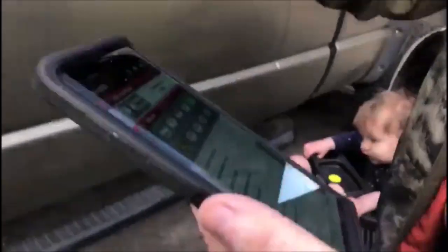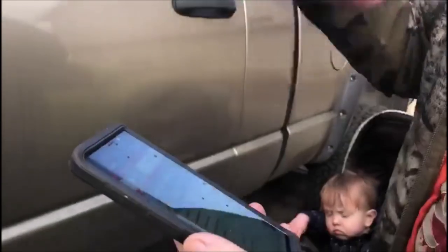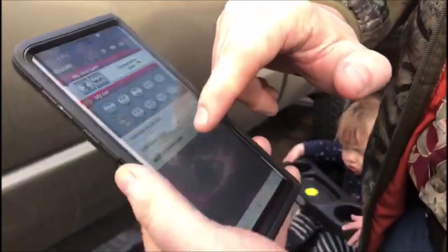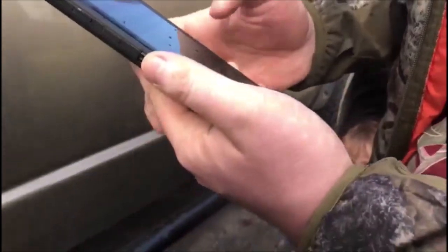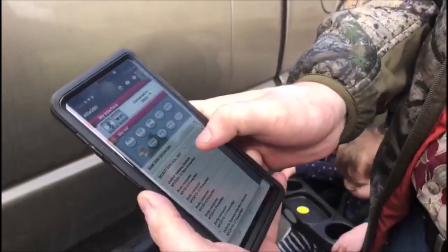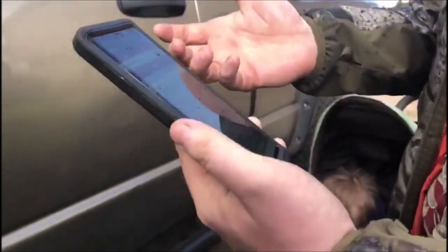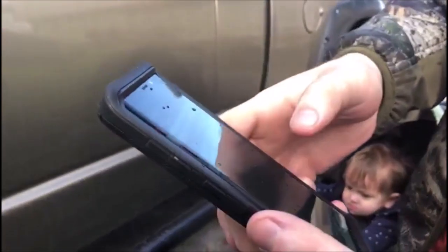I'll just show you a couple of things I can do with it. A couple of people have asked me because this program will allow you to adjust the tire size for the computer, so that your speedometer will read correctly. I'll just walk you through that real quick. For me, I access the body computer, and you pull up the different body computers. I select model year 2006 — I'm not sure how well you guys can see my phone — then Central Gateway, and then you tell it you want to connect, go ahead and talk to your OBD2 reader, and tell it you want to talk to the body module.